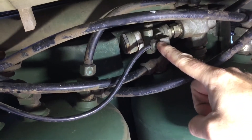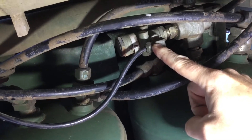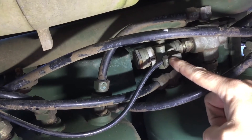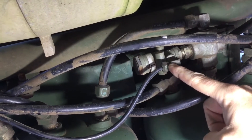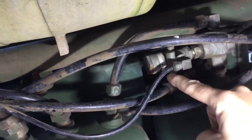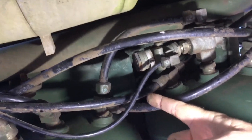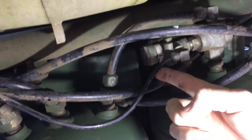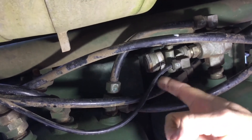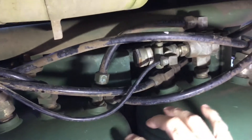This is a remote control valve. It has park air applied to it, and when you remove park air and set the parking brake, it opens up this bottom port. This little quarter-inch line feeds over to your hydraulic manifold valve. This is your air supply for your air-operated pump, so it can draw air from both the primary and the secondary service tanks.